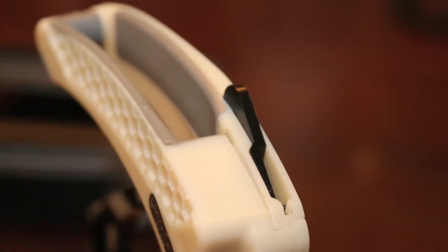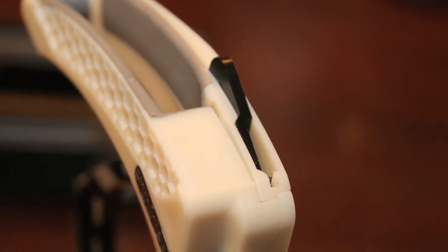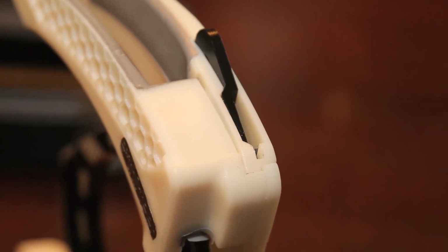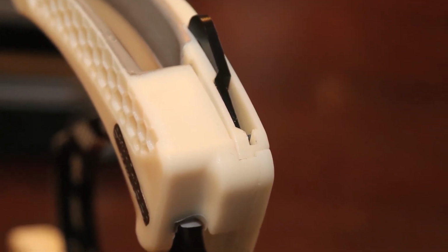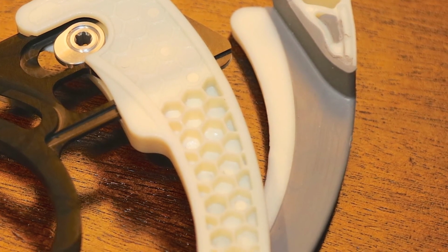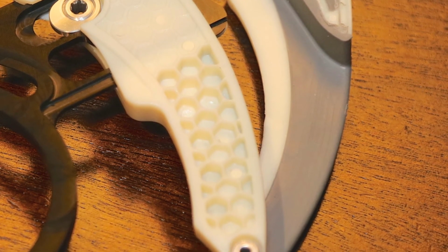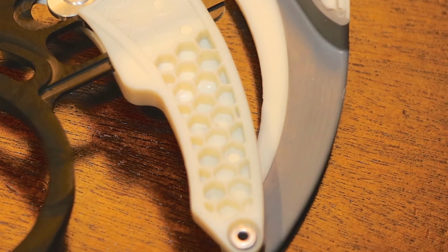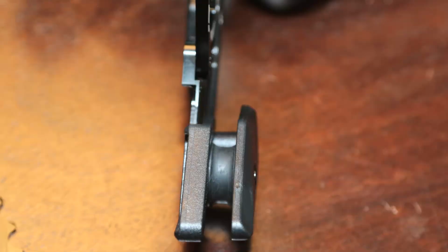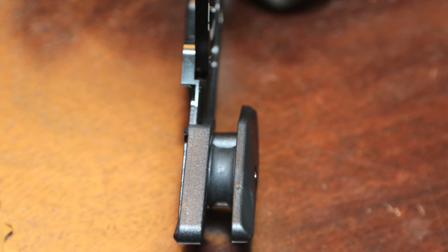One thing that we've run into with a lot of the racers, like how can we reduce the noise and make the guides more silent and roll better? So what we've done this year is on the upper sliders, they'll now have a co-molded process on there. So the internal portion of the slider, so anywhere the chain can come in contact with the plastics, there's going to be a softer durometer rubber co-molded in there. And basically that will be absorbing all vibration and the noise off those guys.